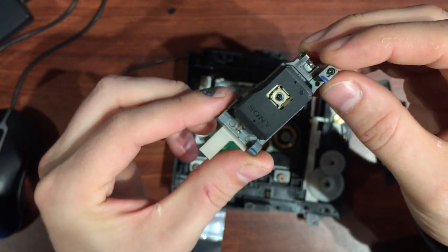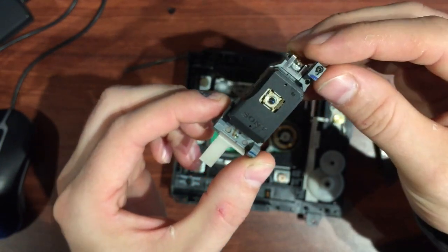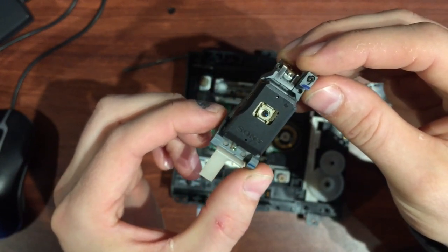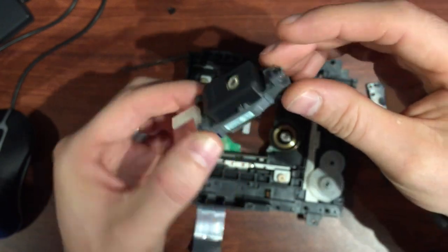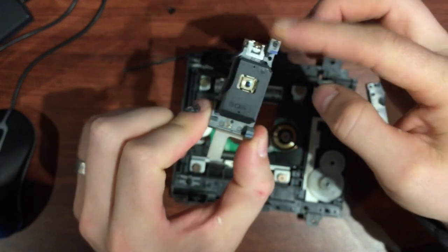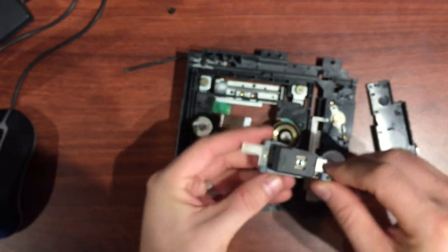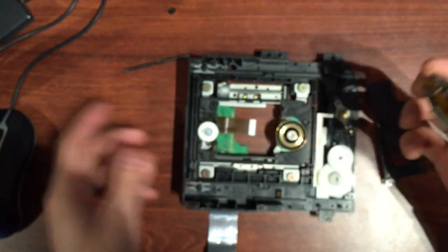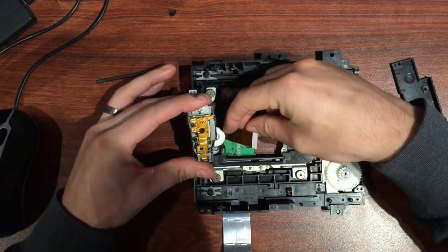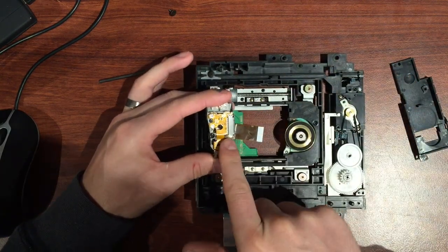PS1 lasers are much cheaper — you can get them for $10 to your door — but these ones are a bit more. So if you've got the need, definitely replace it. Let me just stop the video and redo this little part, as it is quite awkward. I like to flip this upside down on the left side, wrap the ribbon into it, and have your little locking clip out. Grab your ribbon, bend it up underneath, go on top of the dark part, and feed it all the way in until it stops.